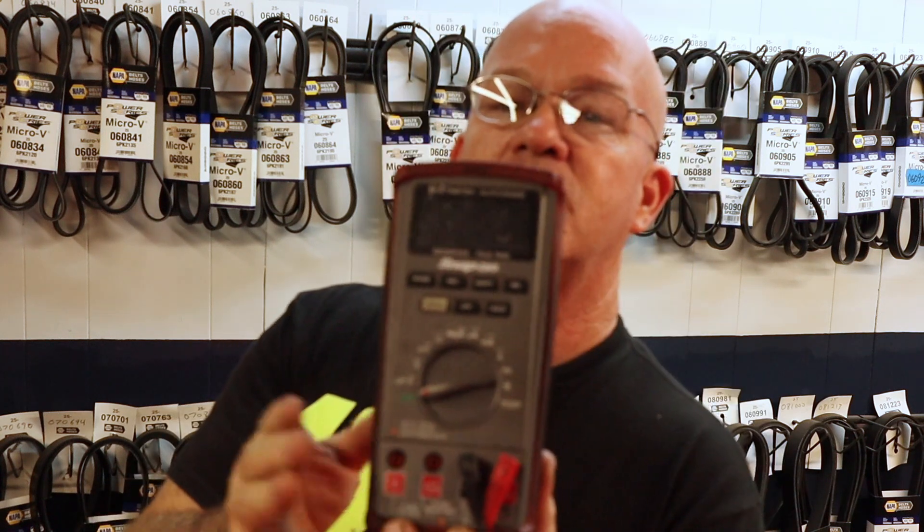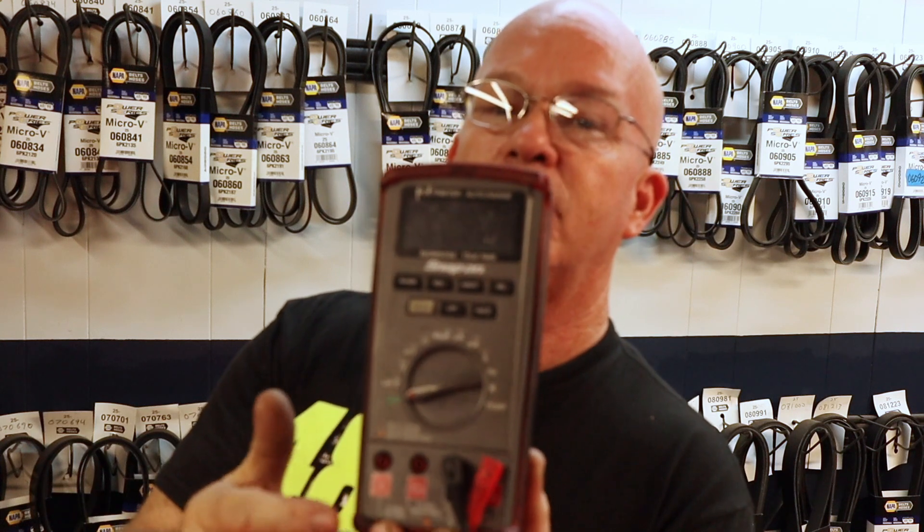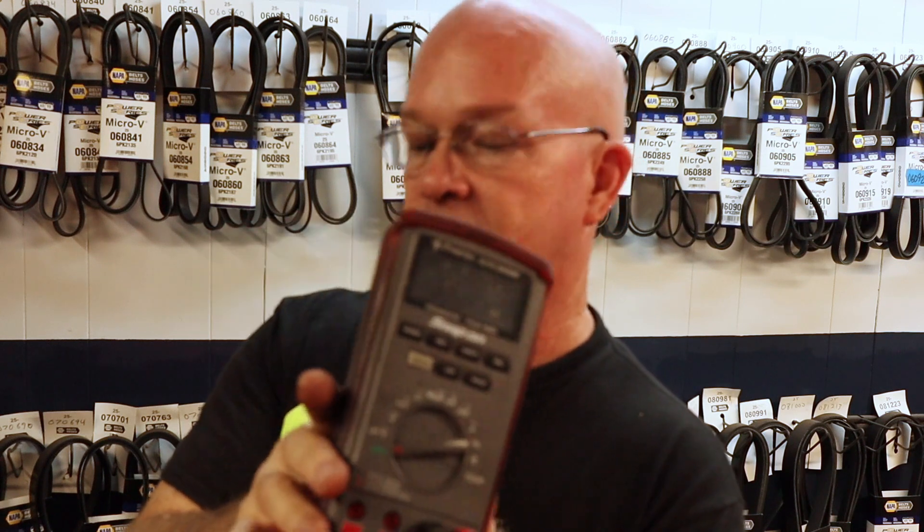You don't want to put amperage through the meter because it'll blow the fuses inside. This is only going to show you voltage. A test light tells you if you're able to take a little bit of load through the circuit, but a voltmeter tells you a lot more. You can watch the voltmeter switch even on a frequency circuit — something controlled with hertz. This meter has a bar graph at the bottom, and you'll watch it jump back and forth so you know it's duty cycling. When you're working on flat rate, you want everything to be fast and easy.